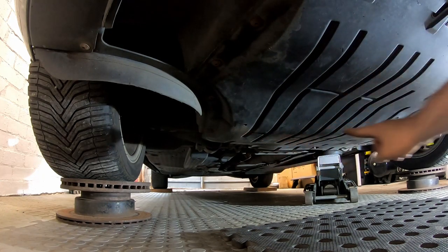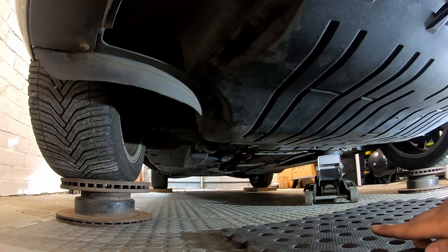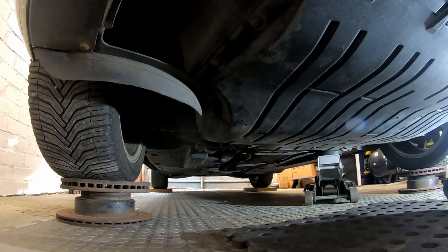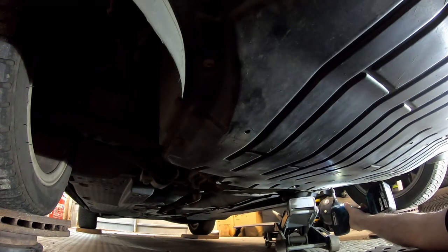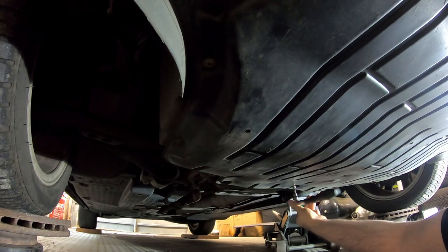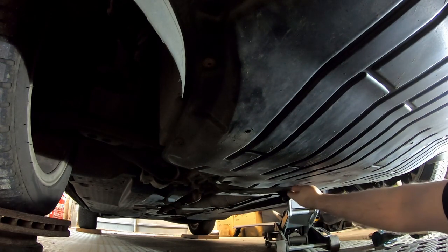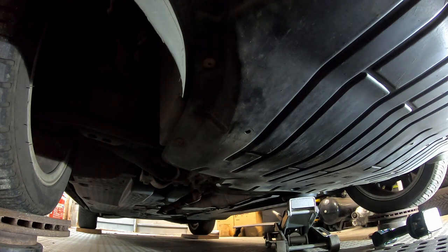Normally there will be three T30 screws across the back and T25s around the sides and front. Unfortunately, one of the T30 bolts snapped and I've drilled and re-tapped that one, using a cap head Allen bolt as a replacement — that's why I need that tool. It's always a good idea to put some anti-seize on these bolts, especially because they're steel bolts going into an aluminium subframe. These are already coated in anti-seize, but I'd suggest anyone that has them out does it while they have the chance.